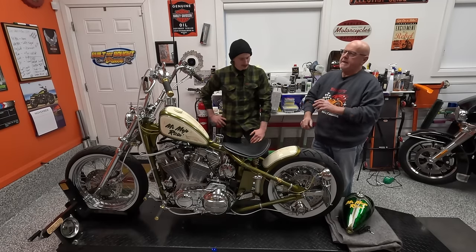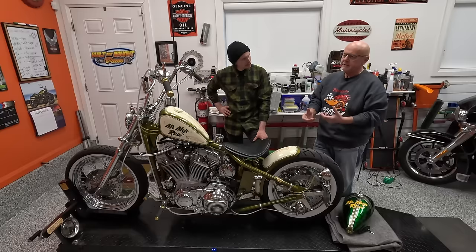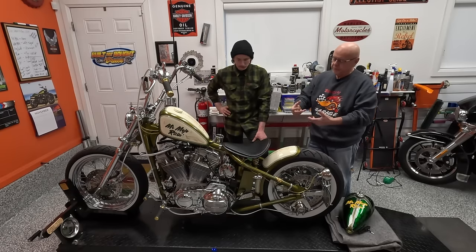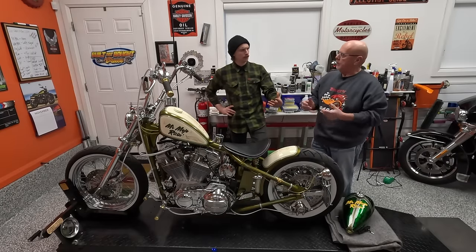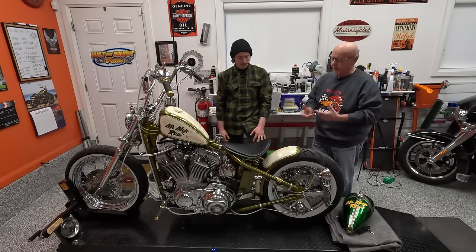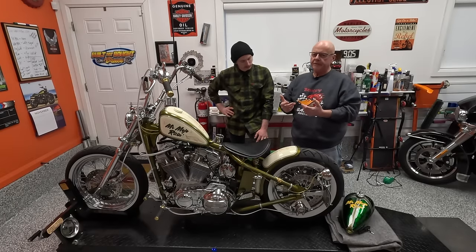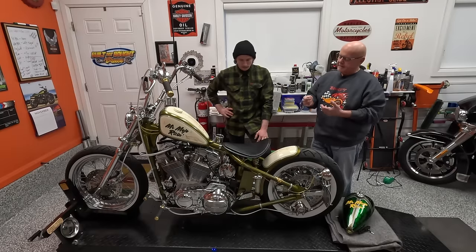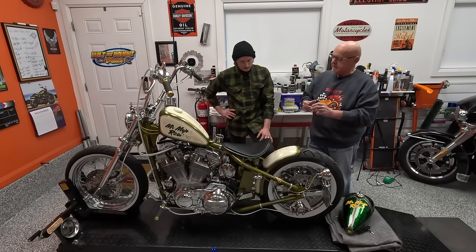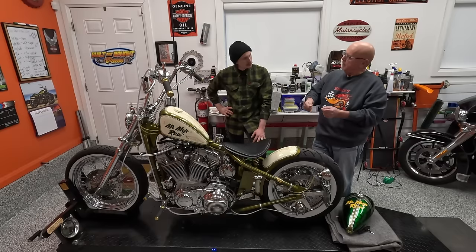I've got to stop you there - there is no keys, nothing on this bike. You don't need keys. So what I did - the Moto Gadget is an excellent product. That thing is indestructible, makes wiring so easy. Beautiful thing about Moto Gadget - it's all ground activated rather than voltage activated. So there are 22-gauge wires running through the handlebars because all you're doing is grounding the input. No current, very little voltage. Running grounds is really easy and very safe - you don't have any situations where a wire with 12 volts can chafe and ground out to the edge of a hole. Except the Moto Gadget fob system - I think they missed the mark there. It's almost like a metal coin that goes on your key chain, and there's a sensor that you have to mount on the bike in a position where you can pass the coin under it.